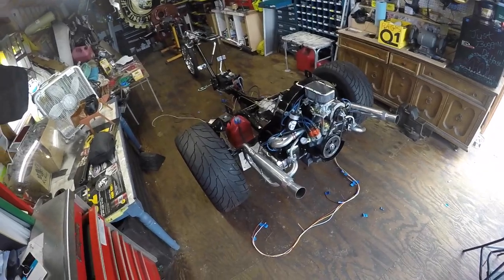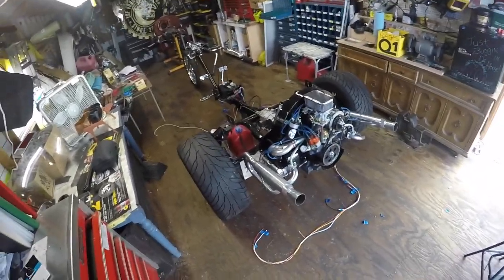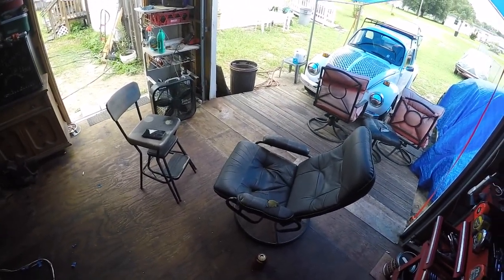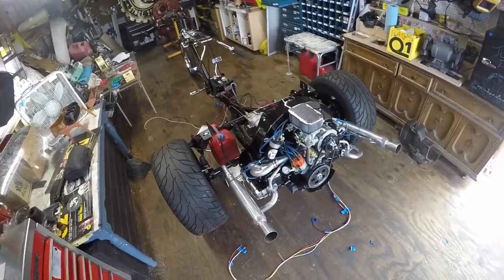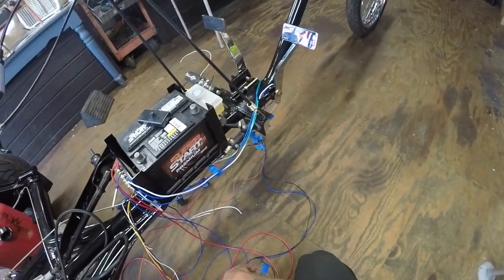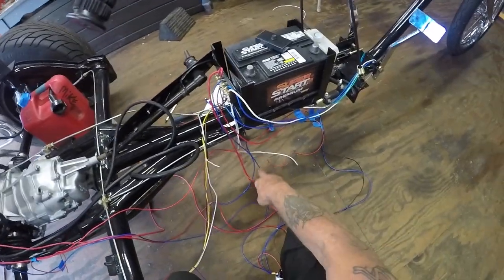Getting on with the wiring harness — I decided to use the board for something else because it took up a whole lot of space. I've got another car that came back with really bad wiring, a shorted stereo wire under the passenger seat, so I don't have all that space. I've got a lot of excess here — I'm labeling it all. I gotta put a grommet in here, and I'm going to take this sending unit wire off and just come off directly, eliminating one wire.